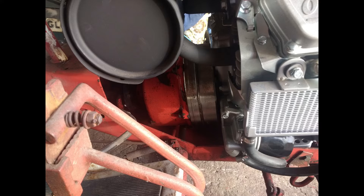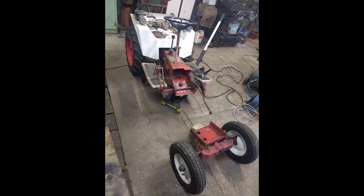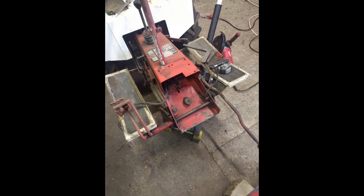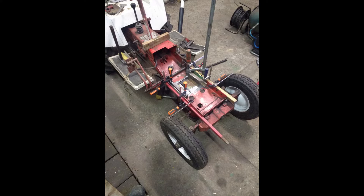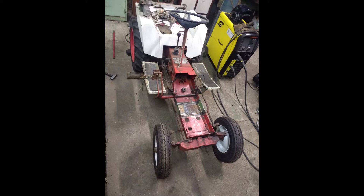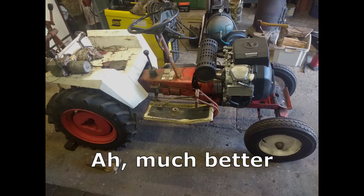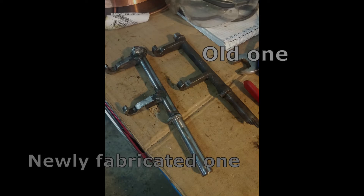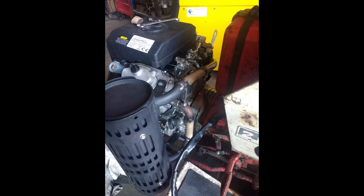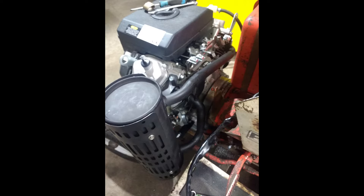When all was done, it was time to fit the engine in the frame. The new engine, being wider and a bit longer, was not going to fit, so I made the decision to cut the frame and stretch it 150mm — because why not at this point? Also, the exhaust was interfering with the fuel tank, so I had to make it a side exit, like on the old vineyard tractors. I think it turned out rather nice.